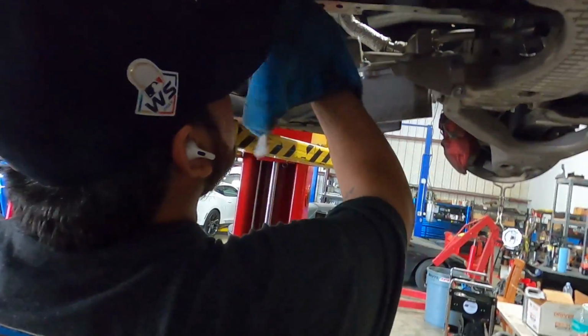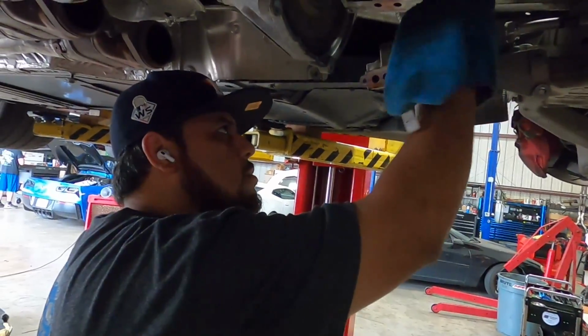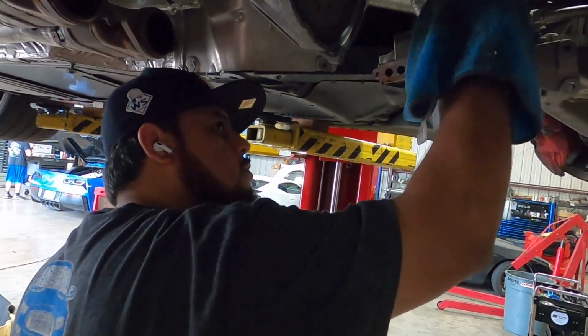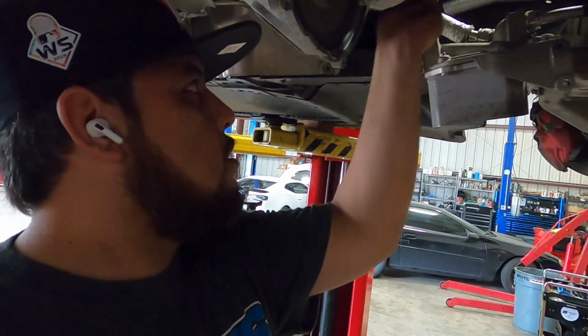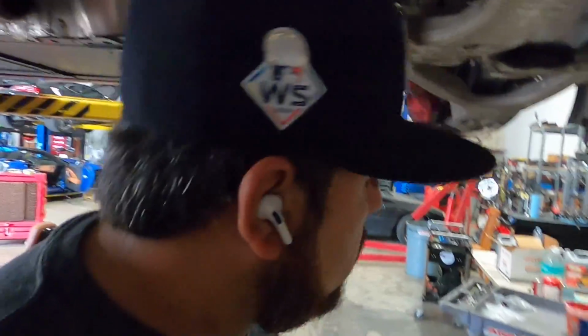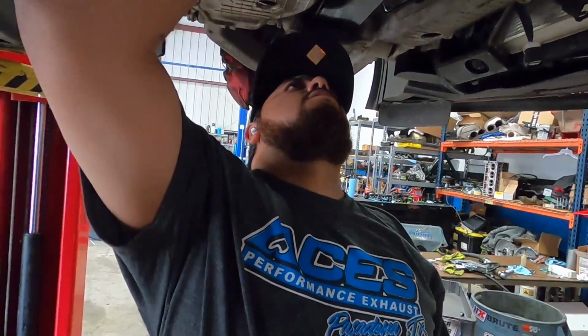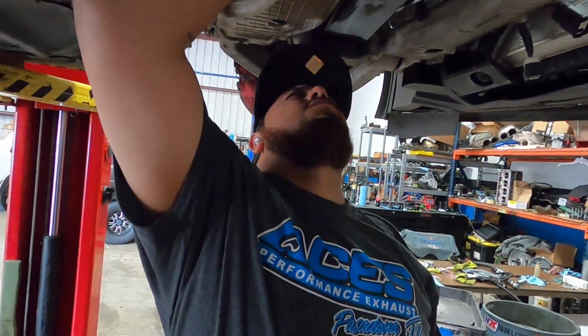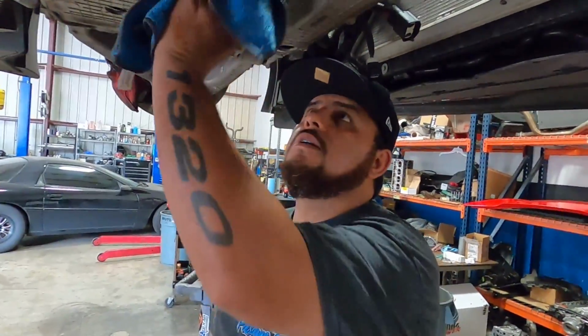And then this thing obviously got a custom cam. This thing's getting headers as well, right? Yeah, so it's got, I guess it's like their 750 package or something for the C6. We did the heads and cam. Actually it's just valve springs and stuff on the head, nothing too crazy. And the basic bolt-ons. Okay. Like headers, X pipe or cat back, whatever you want to call it. I think we're leaving the stock lower with just the upper pulley. And that's about it. Nice.